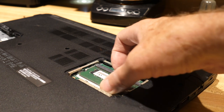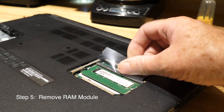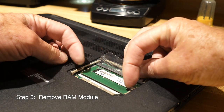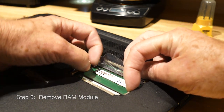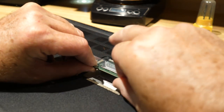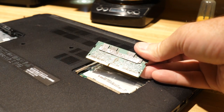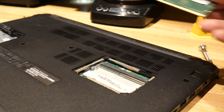On the other side of the laptop you might have a little piece of film here protecting the RAM. Go ahead and pull that back — there are a couple of little clips, so slide those out of the way, jam the RAM up, and yank it out. And there it is — that's our memory and our RAM.